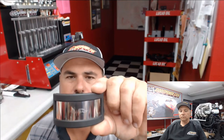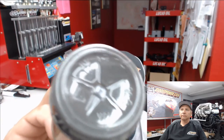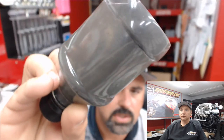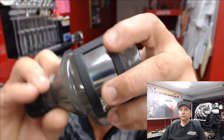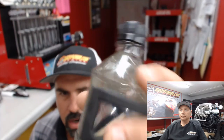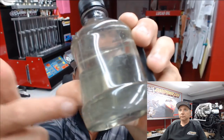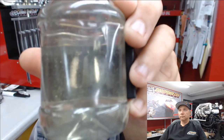These little magnets go conveniently onto the filters. This display is clear motor oil with a little bit of dirt and babbit — brand new motor oil with debris added for testing. If you simply hold the magnet on it and shake it, a magnet will clean it all up in just a second. You can see how clear it is now, and all that material is sitting against the magnet. This gives a lot more life on your filters, keeping unfiltered oil out of the motor.